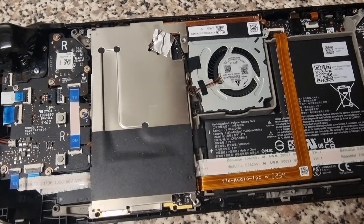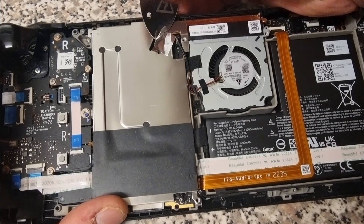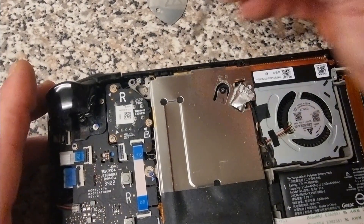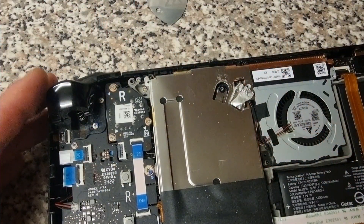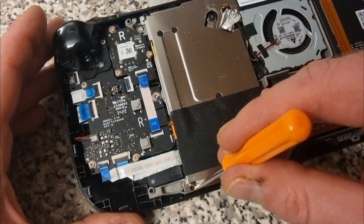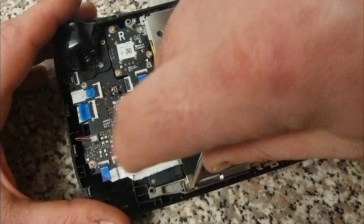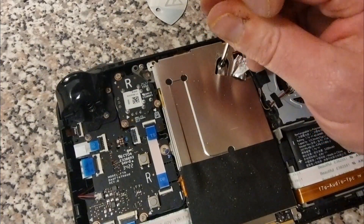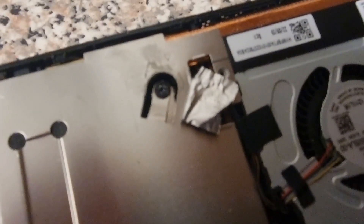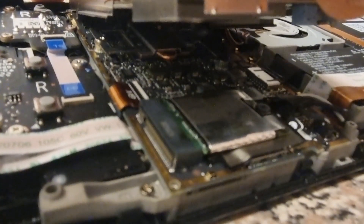These are the internals of the Steam Deck — you can see the main board. Note there are a couple of different versions of the Steam Deck's internals. First, gently remove the small piece of sticky electrical tape in the corner to expose a screw at the top left. There's also a screw at the bottom left of the shield, one at the bottom right, and another under a piece of metal tape. Remove all of these screws, and if needed, very gently wedge up the shield slightly to expose the M.2 drive.